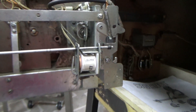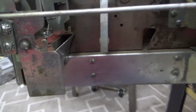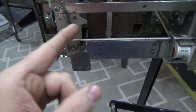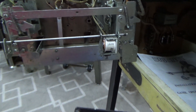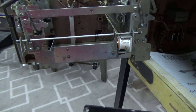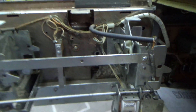You can just unplug it if it's making too much noise for you. Here's what it does — this is the only purpose of it. When you turn the game off, that coil releases because there's no power on it. What that does is it moves a couple little wires that move into the coin mech and make it where if a quarter falls through, it hits that wire and goes back out the front. The whole purpose is so that whenever you walk up with the game off or in a state where it can't take a coin, the quarter will be returned to you. So the whole purpose of that circuit is so that it doesn't take your quarter. And everybody said they were trying to rip you off — look, they designed that whole circuit just so you wouldn't lose your quarter.